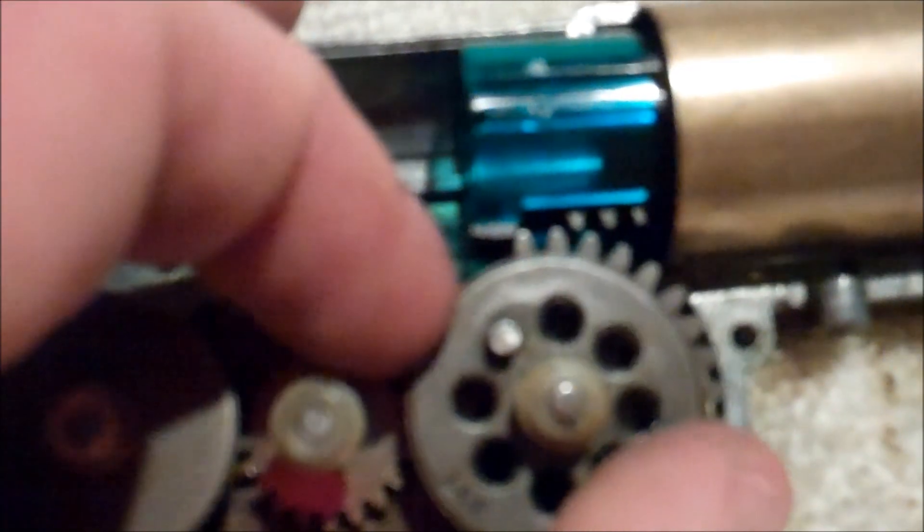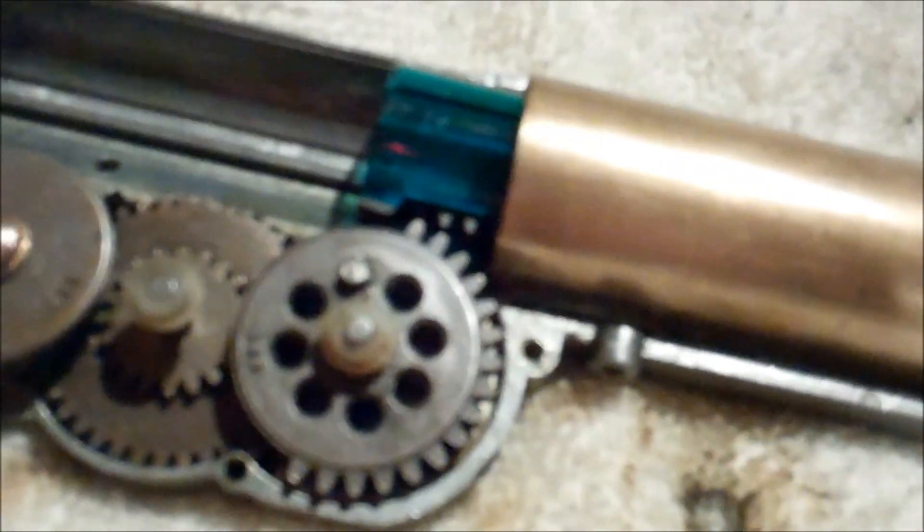I took the rest of the grease out with some Q-tips and I've already shimmed it just using the same bushings — nothing extra to use. I've also done the angle of engagement, as you can see, pretty good. So I'm just going to go ahead and put some new grease in here and put it all back together.